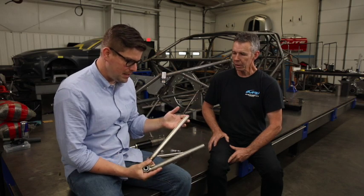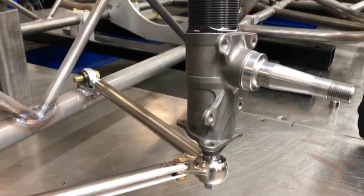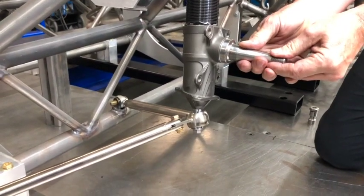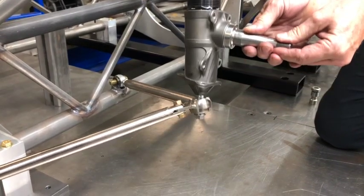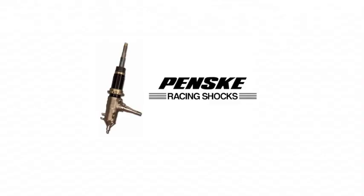These are new control arms for the Penske long travel strut. In the past, most all brand-name struts have been a three-inch travel strut. Penske has now developed a long travel strut, which is about an inch more travel, and it allows the tire to stay in contact with the track longer and ease the front end setting down more gently.